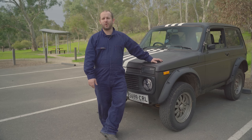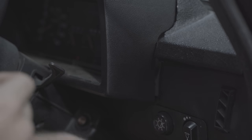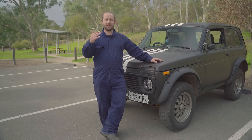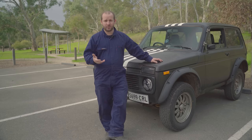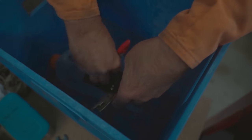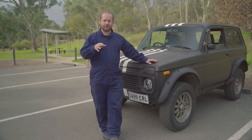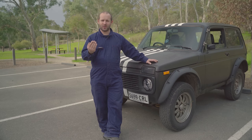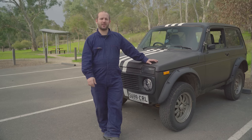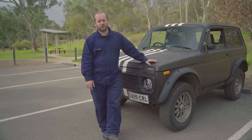When you start this car up it kicks into a really high idle, because it's got an automatic choke on the aftermarket carburetor. When you start it the idle is really high; touch the pedal and it comes back down to a normal idle. Before, the idle was still high and you could pull the accelerator pedal back toward you to drop the revs. We tinkered with the idle arm and now it idles nice and purrs.